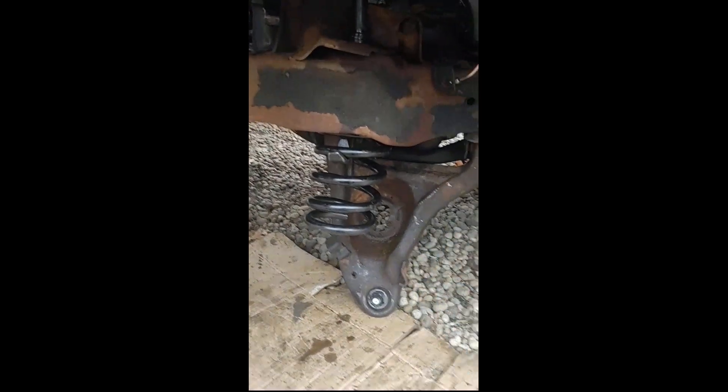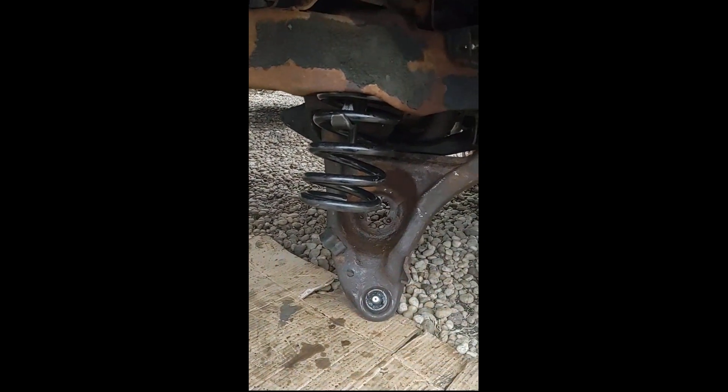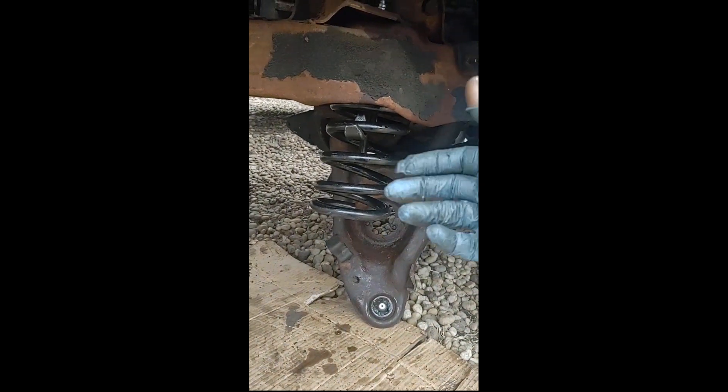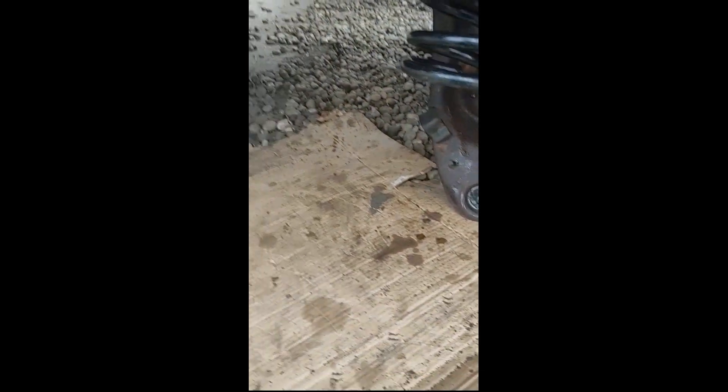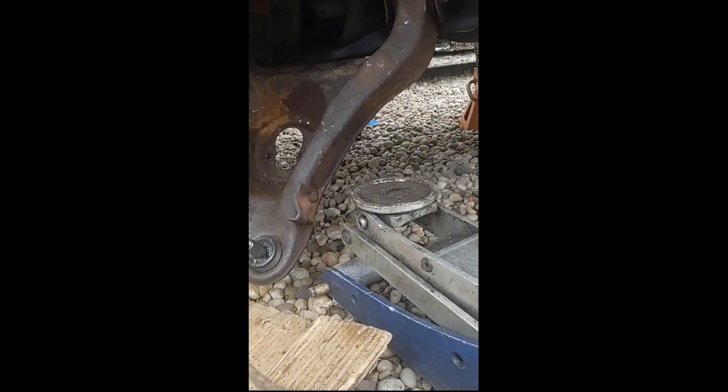When I took the old rubber isolators out I forgot to buy new ones, but I bought these rings a long time ago for a different car that I didn't use - that's why I had a hard time finding them. I just reuse it with tape wrapped around four sides, but sometimes the rubber is off center, which is why it goes funny. Also, don't forget to oil your threads - you can see the penetrating oil dripping here. You catch the spring compressor hook on the spring pocket that way it can't go sideways out of there.